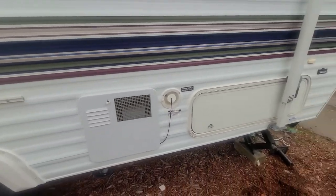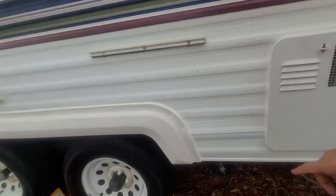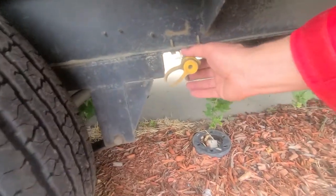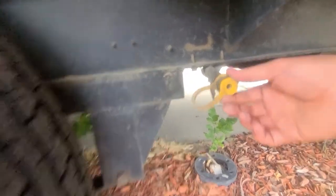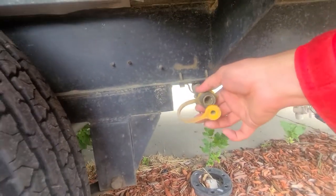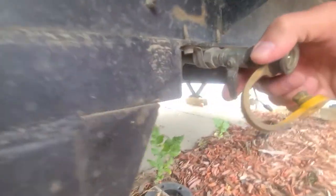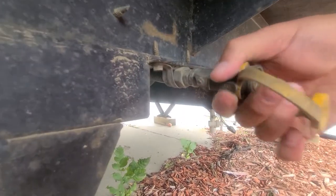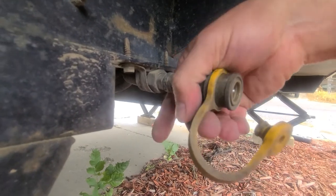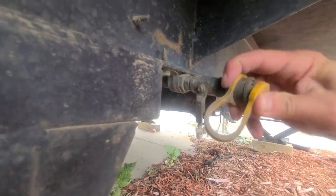That's basically all the propane systems. There are a couple of cookers stored in there — one's a barbecue and one's a stove griddle. There's a rack where it sticks on, and then there's a little line that comes and hangs down. You go ahead and hook it in here just like any other air compressor quick-connect fitting — you pull that back and pull it out. It's hard to do one-handed, but just like a quick disconnect for an air compressor. Here's the actual valve: turn it in-line to turn on, and always want it perpendicular to the line whenever you're traveling or not using it.